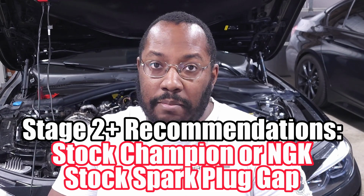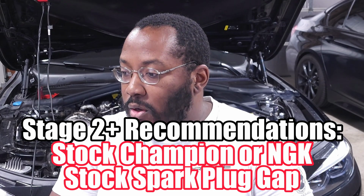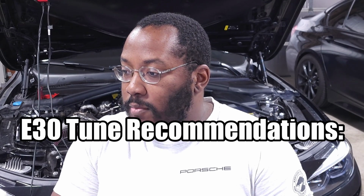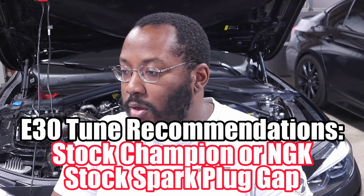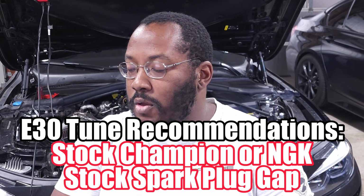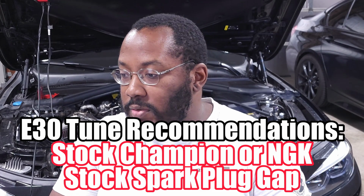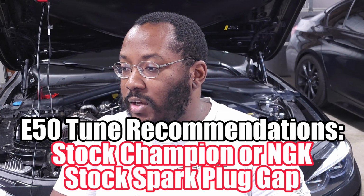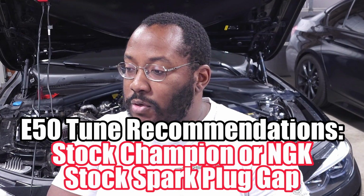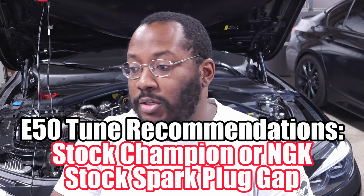Now, those are just kind of basic pump gas recommendations, but let's say you're running some ethanol. So if you're running E30, I recommend running OEM spark plugs. So that's NGK 94201 and Champion 9425. Or on a TU engine, that's NGK 96206. If you bump that up to E50, then I recommend the OEM spark plugs. That's NGK 94201 or Champion 9425 for Gen 1 and NGK 96206 for Gen 2.